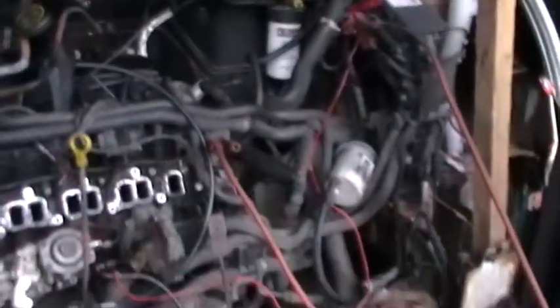So we plug that into here on the stop solenoid, which is a bit difficult with one hand. We'll go and try it. Ignition's on, MIL light's flashing nicely. We've got the jump leads on, so take two — let's see what happens. There we go.